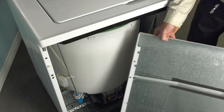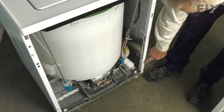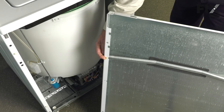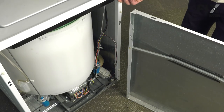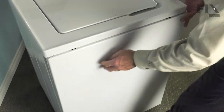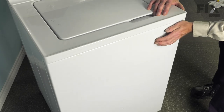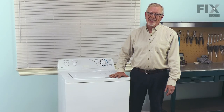Now, when installing the front panel, what we want to do is make sure that we line up the slotted openings in the bottom of the panel with the hooks on the base frame. We'll also have four plastic studs on the front edge of that cabinet that need to line up with four round holes in the front panel. We'll also have a single metal locating pin on the right-hand side of the panel that needs to engage this clip on the cabinet. The spring clips located on the bottom of the main top will engage the slotted openings in the top of the front panel to lock it in place. Make sure both bottom tabs are engaged, plastic pins line up, and then just press on the top so that the spring clips will lock in place. We're now ready to reconnect our hoses and the power and our repair is complete.